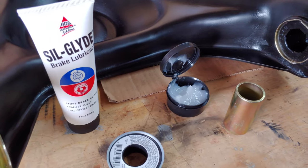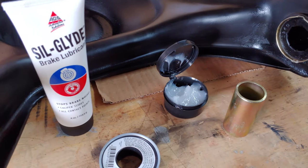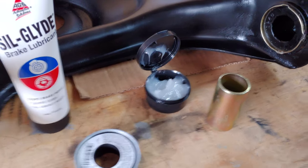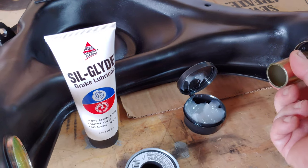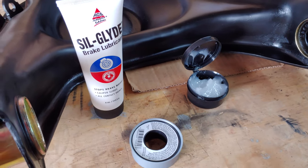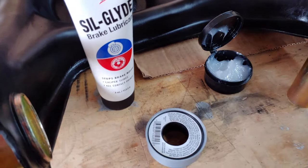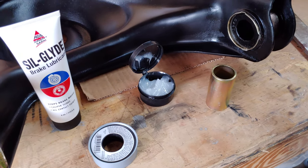What you want is something that's going to be, first and foremost, waterproof and anti-corrosion. So where does that leave us? We're using silicone grease on the outside of this, but the way this is set up, there's virtually no commingling of the lubricants. So you could use a different grease on the inside. And why would we want to do this? This silicone grease is not my first choice for a metal-to-metal bushing. That isn't what I would use.